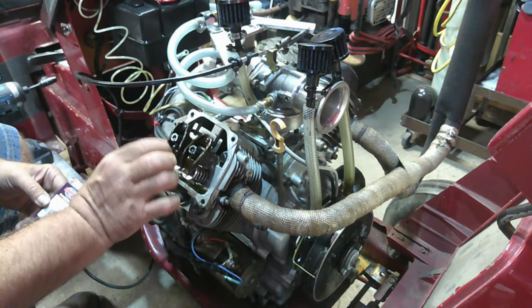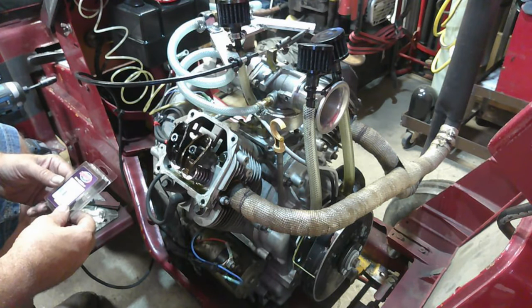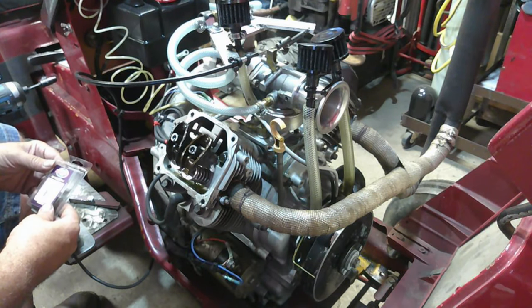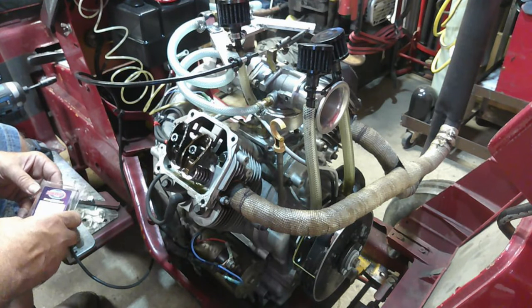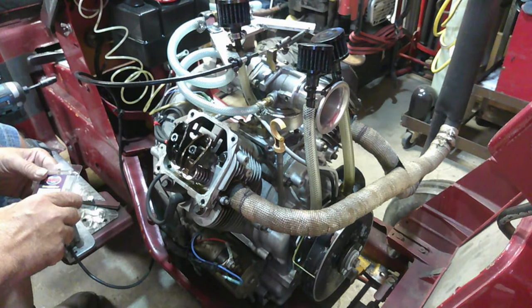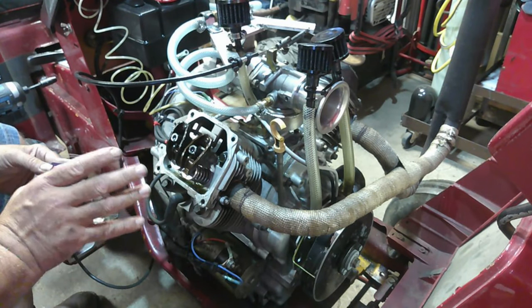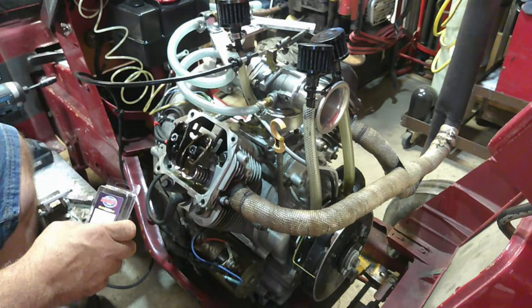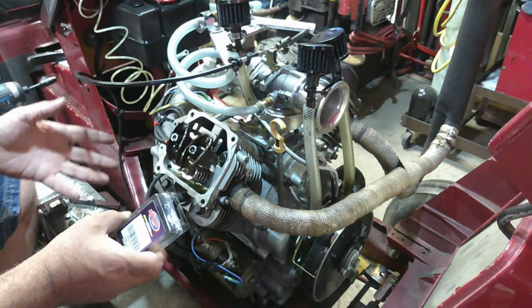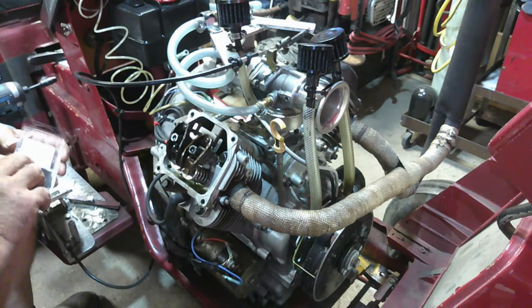This is all they had in the diameter I wanted with the outside and inside diameter. I usually use Comp Cams ones — going back to my drag racing years in the early teens. We used to use the Comp Cam ones; you used to be able to buy them individually. Everyone might be a little different, so to get equal pressure on all of them, or different pressure between your intake and exhaust — you could buy different thicknesses: 15s, 20s, 30s, and 60s. But to get that pack it was like 50 bucks. This was like 10, so we'll just double them up. There's 16 in here, so there's plenty.